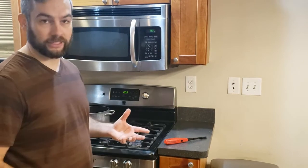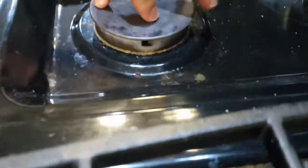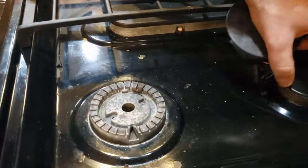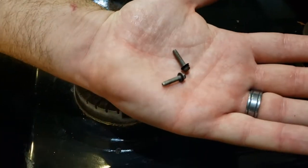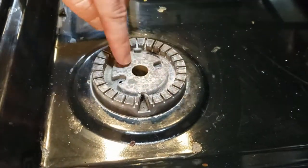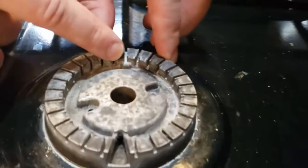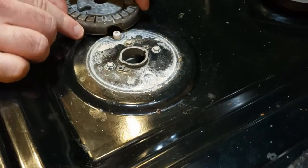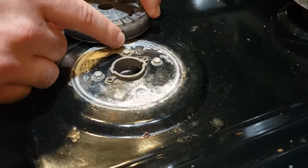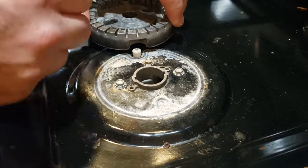The next one is a fuel or gas delivery problem. So what we have here is this is your burner. And if you take off — this is not bolted on, it just kind of sits there by weight, same thing with this one back here — you can take that off and set it aside. Normally there's two screws or bolts that go down in there. Fuel comes up through the center hole here, hits the bottom of this plate, gets pushed out these holes, and a little bit goes through a small hole right where the igniter's at. On the opposite side you have this piece, and it sits over top of it — you can see the U shape — and it creates a little tiny combustion chamber where the gas mixes with your ignition and causes the whole thing to light.